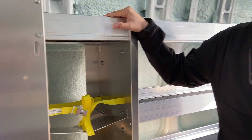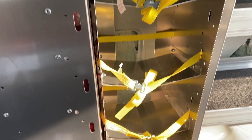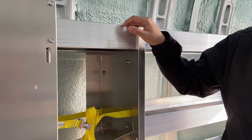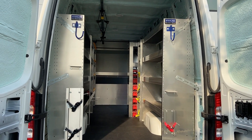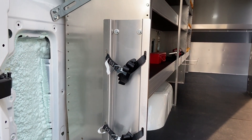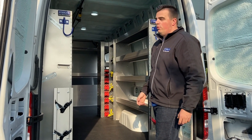Since this van is particularly for a refrigeration company, storage is a big focus. There's not much space when you have a shelf unit and a parts keeper, so we've created a five-tier bottle holder for refrigeration to maximize storage. At the rear of the van you get a full look at the entire build — the driver and passenger sides are very similar. We have nitrogen and oxygen tank holders with straps, and an eight-inch swivel hook so you can hang electric cords or even your jacket for the day, making sure you have everything you need for the job.